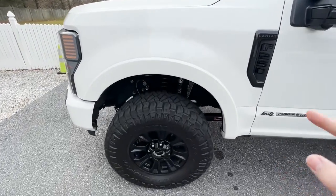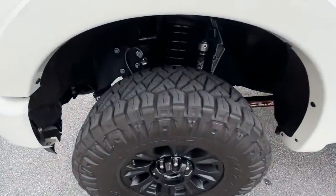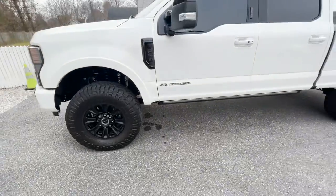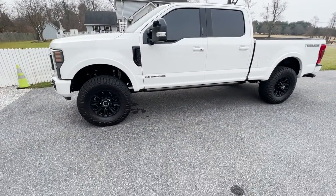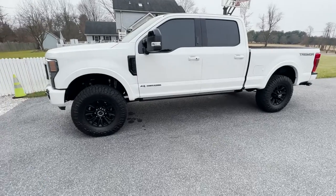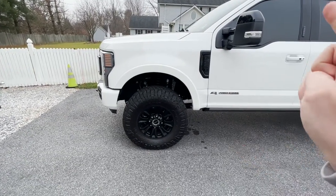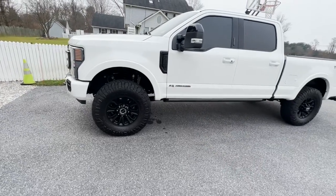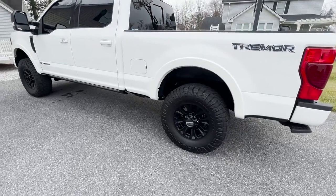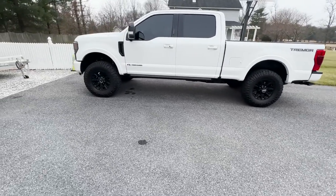This vehicle has the full Carly commuter suspension package. I'll bring you guys in so you can see the hardware and go over what each piece is. The regular Tremor package on an F350 and F250 lifts the truck about two inches, and it comes stock on 35-inch tires. This one has the 37-inch Ridge Grappler tires, and the Carly commuter suspension raises it about 2.5 inches — so it's only about an inch higher than the Tremor stock. If your truck does not have the Tremor package, it'll be significantly higher than stock.